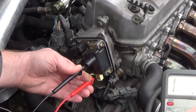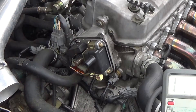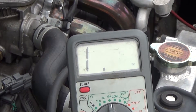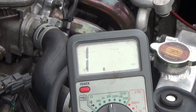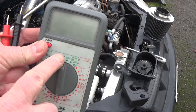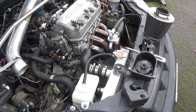I forgot to set my range, so I'm going to do that and show you in a second. In my case it's roughly 15 kilo ohms. I set this to 20 kilo ohms range, so I'm getting less than 20 kilo ohms, which is good. The first test was just ohms — around 0.7 ohms. And the second one, which I just did, was 15 kilo ohms. So you just want to make sure it's in the correct range.